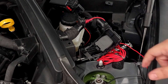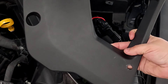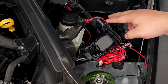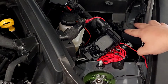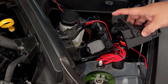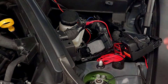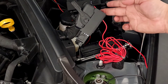As you'll notice, I went ahead and removed the cover — this is held down by three push clips located here. You'll also see some extra wires here; that's for the Velostech power switch, so you would not have those if you don't have that. There are two connector plugs here which are already disconnected. To remove them, push on the clip on opposite sides until the lever comes up and push all the way until it's released on both sides. Once that's out you'll see the ECU.